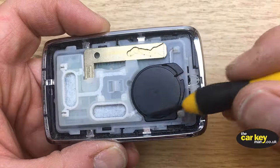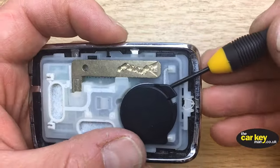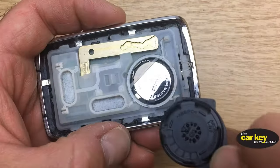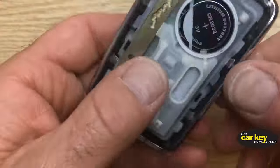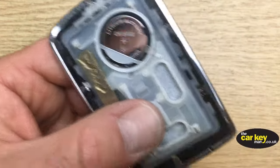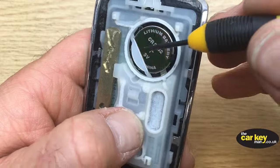Just check that it fits your door lock. And here is your battery cover — you just need to gently prise that open. Pop that out of the way. The battery you've got is a CR2032.